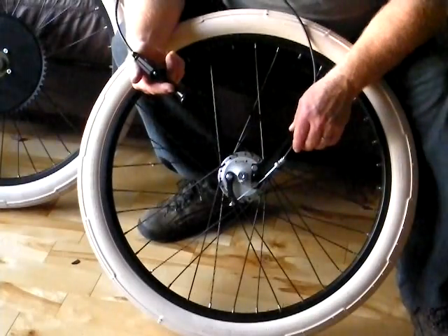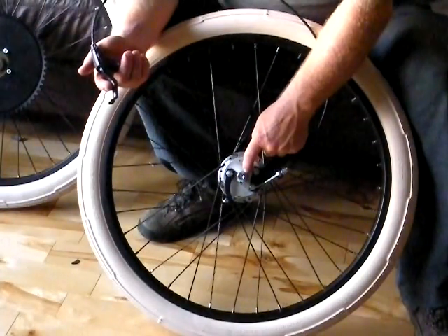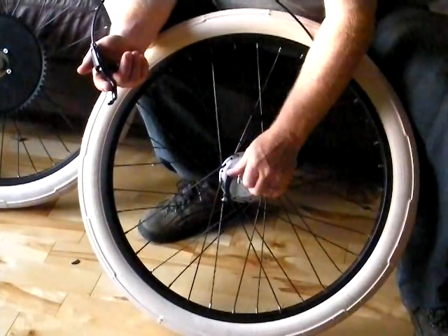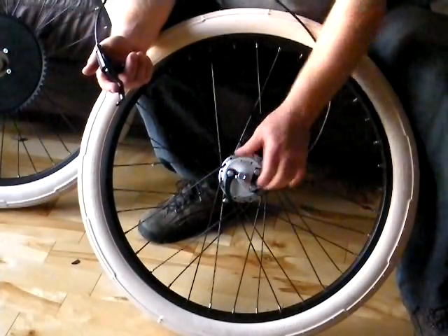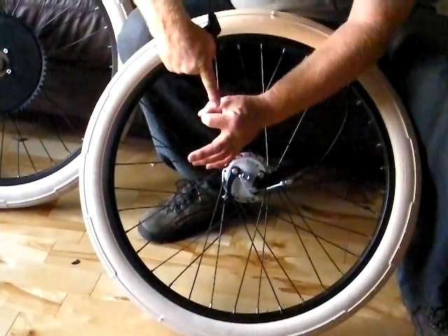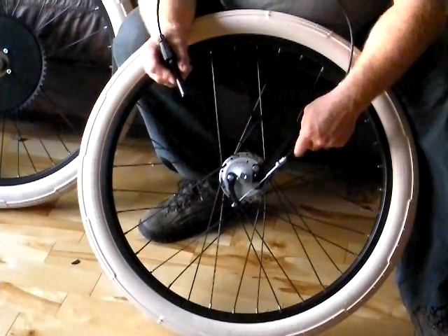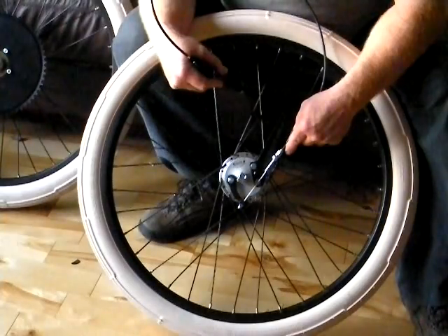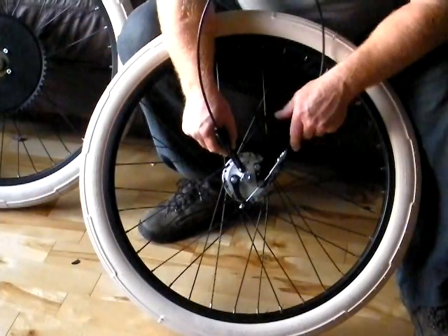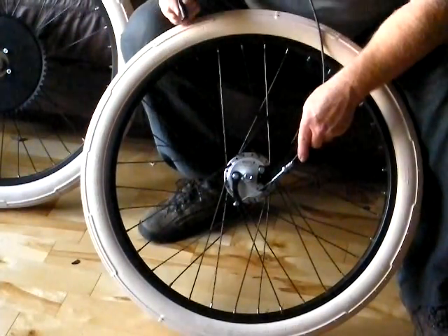One of the features of the drum brake is the fact that Sturmey Archer uses sealed bearings in their front drums on either side. A typical bicycle has exposed bearings that sit in a little cup, filled with bearings and a slot that slides in to hold the bearing. Those bearings are not meant for high-speed applications — they will overheat, get contaminated, and fail very quickly. The sealed bearings in this are a motorcycle-style bearing; they are not prone to heat or contamination and will last a very long time.